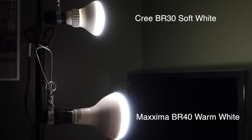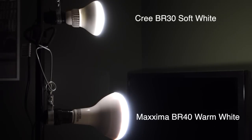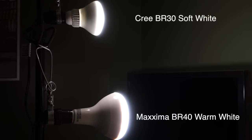Let's run it through our standard 30-second dimming test. As you can see, it dims pretty well and fairly smoothly. There's still a little bit of a stair-step effect you can see with the naked eye — hard to see on camera. Very little, if any, flicker at any dim level and only a little bit of noise, but not too bad — definitely not compared with some LED bulbs of the past. On our torture test, it dims down to 1%, but that 1% is brighter than other bulbs we've tested.